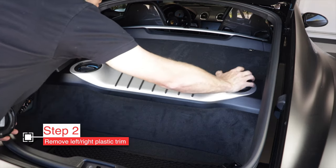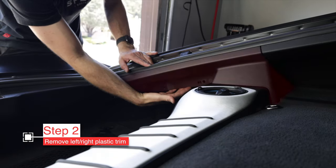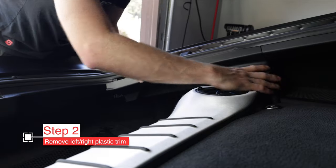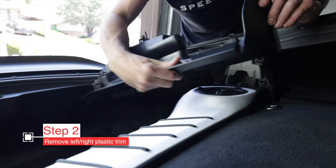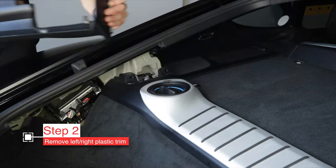Let's remove the caps off the coolant and oil fill. Now we can remove this plastic section — just grab it and pull. It should unclip. Metal clips are all that's holding it in place, plus the little cones to help align it when you reinstall. Take it off carefully — you don't want to scratch the center silver section. Do the same on the other side.